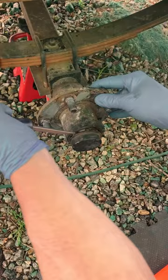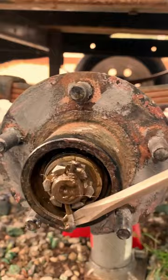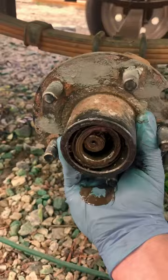Get it up on some jack stands, take off the tire, and pop off the dust cap like so. Now pull out the cotter pin and unscrew the castle nut. You might need a wrench if the threads are a little roughed up around the cotter pin hole. If your hub design includes a washer, take that off and don't lose it. Now it should all just slide off like this, but it may need a few taps from a mallet depending on how long you've been procrastinating.